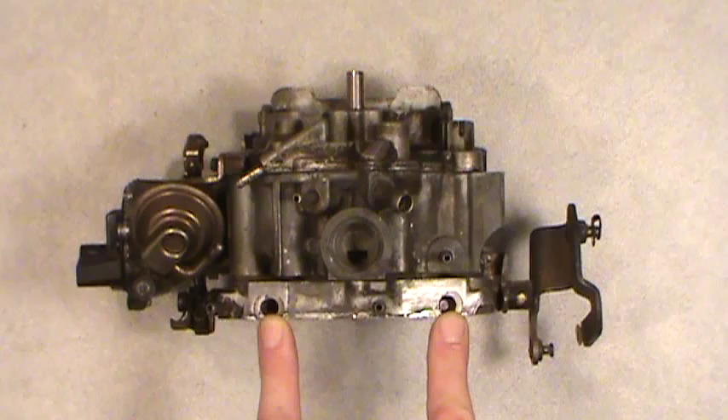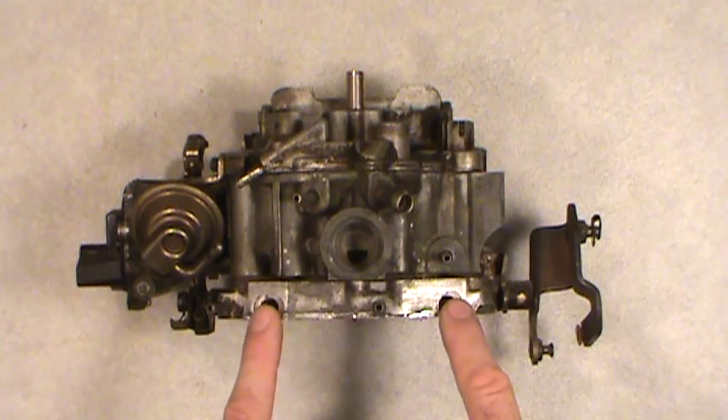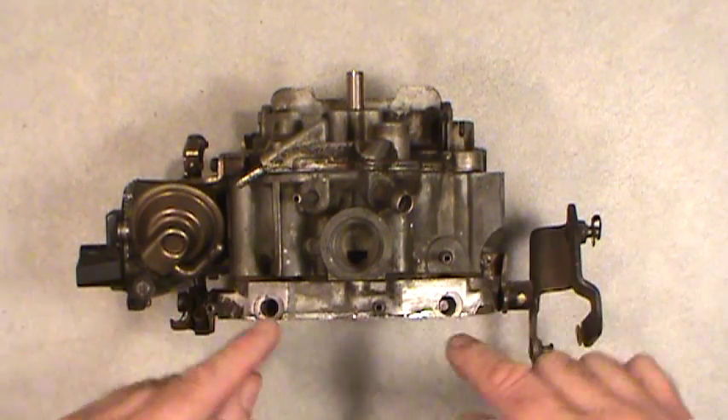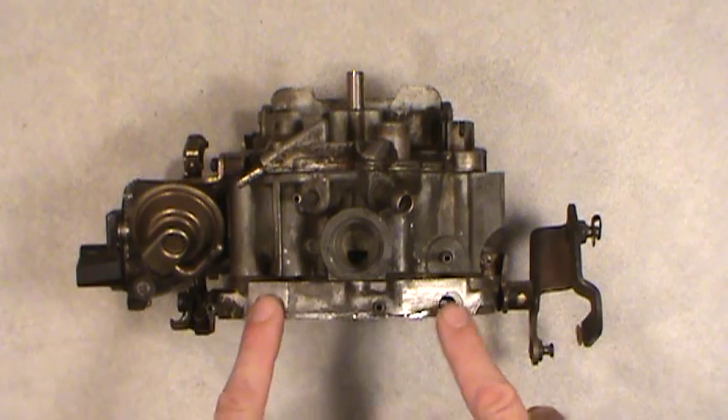What the instructions in a rebuild kit would tell you, in order to get these hardened steel caps out of here, is to expose your idle mixture screws in order to take them out of the throttle body or base plate. That way you can clean the idle circuit and the needles, because especially older gasoline — when it sits around for any length of time — turns into a hardened varnish-type glue that really restricts fuel and possibly even air passages depending on where you are in the carburetor's different circuits. For today, we're doing the idle mixture circuit and showing you how to get these idle mixture screws out.